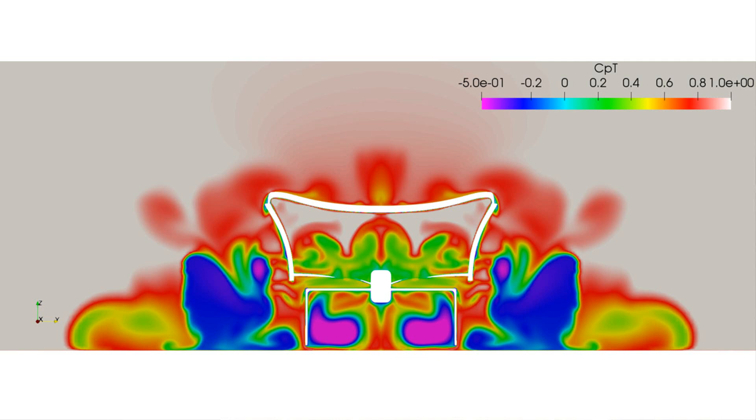What do I mean by this? Well, for example, this is the cross-section of a diffuser at the outlet. You can see how the vortex burst has consumed a large proportion of the total expansion area. It's basically just made the diffuser that much smaller, decreasing its performance potential.